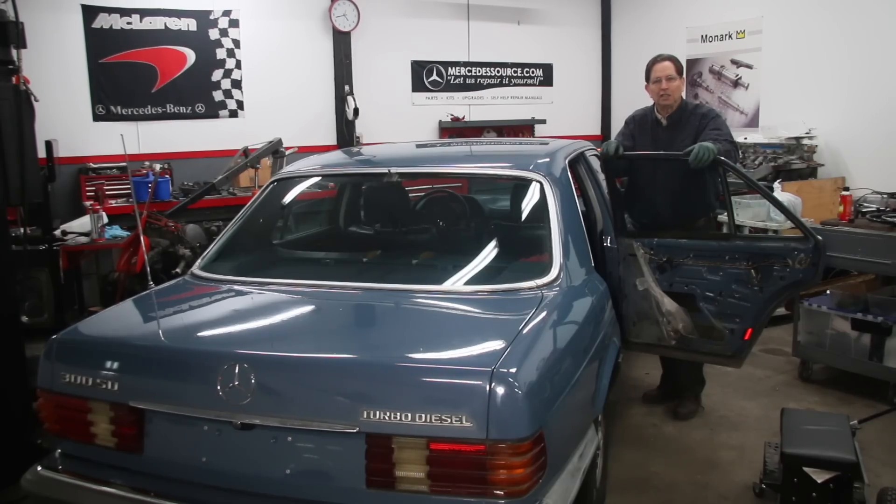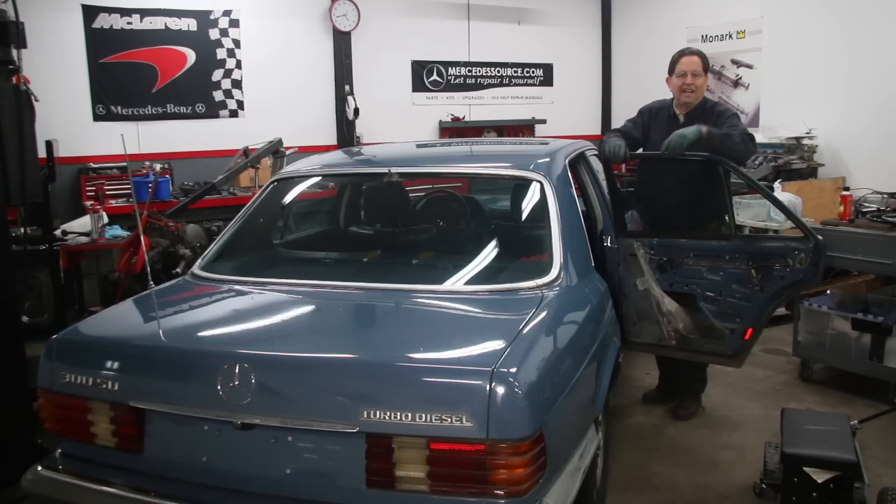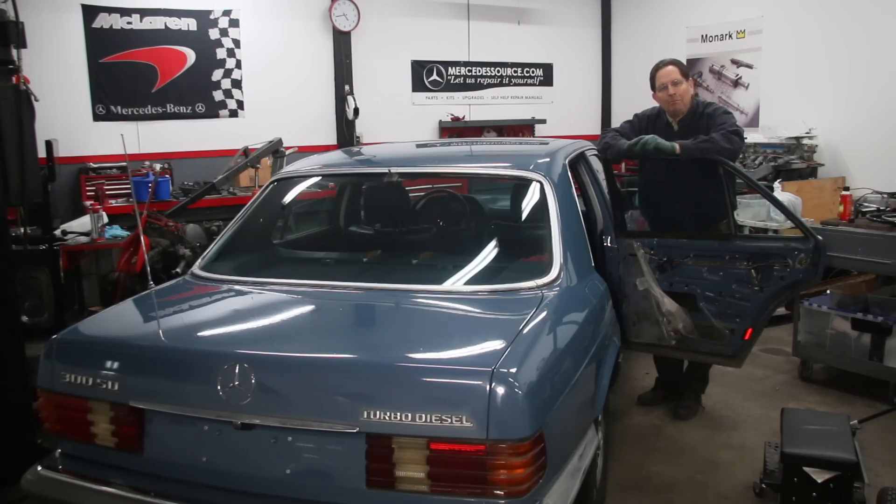The vacuum would be produced when you turn the key on. In the older ones, if it leaks out of the tank the doors don't open. The basic idea was to get a little electric pump that would produce vacuum, activated by your key when you put it in the door to open and close. It's kind of like vacuum on demand — but this is a big but.